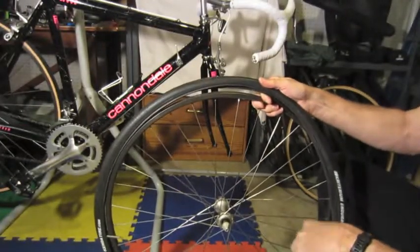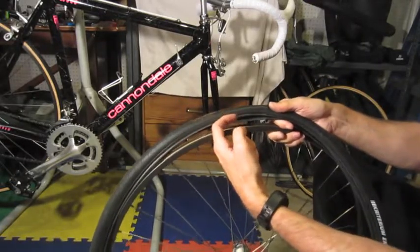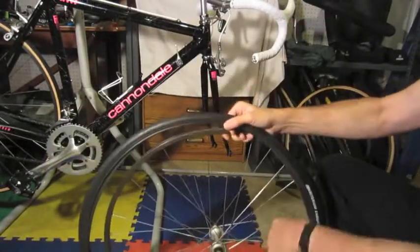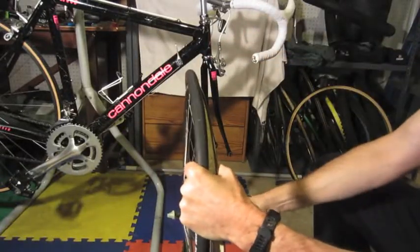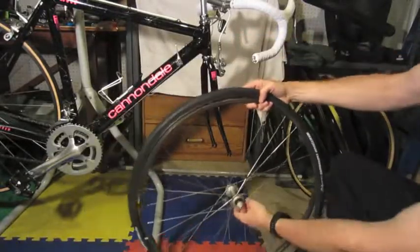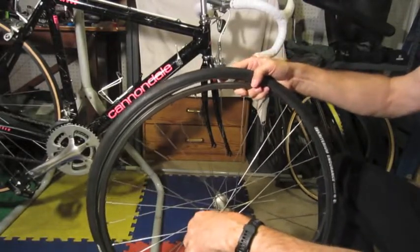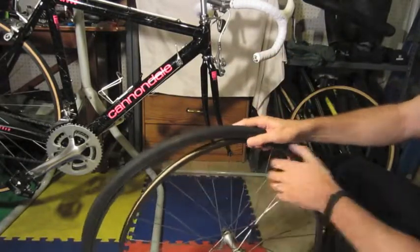I'm getting ready to put the new tire on. Something I wanted to point out is right here — I don't know if you can read it, but it says 'direction' and has an arrow pointing that way. That means when you put the tire on the rim, the tire needs to turn that way — that's how it's designed. The quick release always goes on the left side of the bike. So if your direction arrow is this way, you can tell the wheel goes in the bike this way and will turn this way. I want to make sure I get the directional side of the tire on the right way. Some tires don't have that, but if they do, it's always a good idea to put it on correctly — especially with mountain bike tires; even road tires have it now.